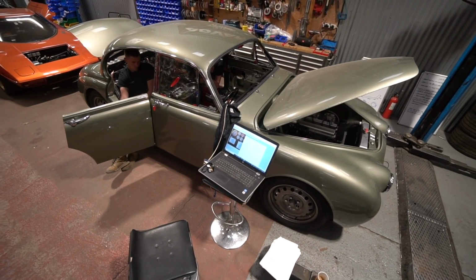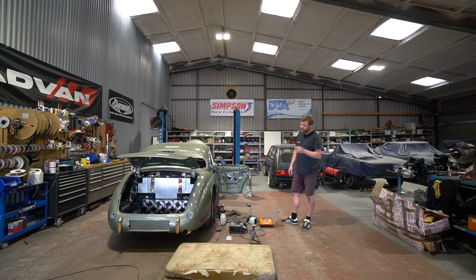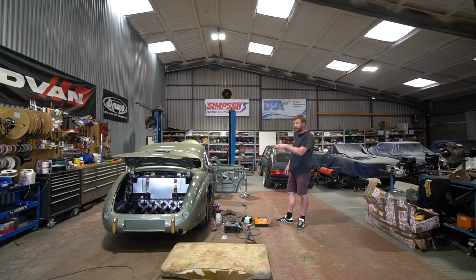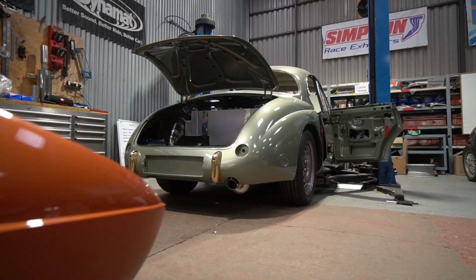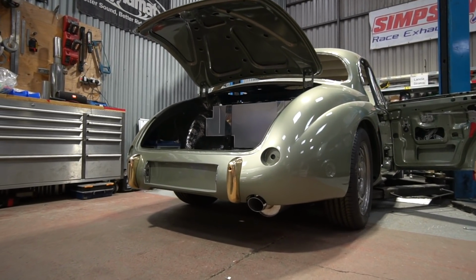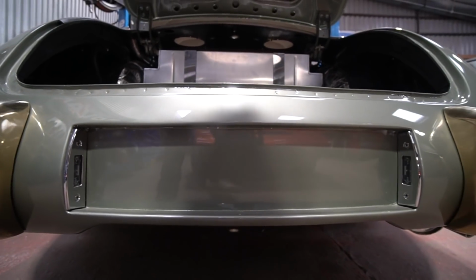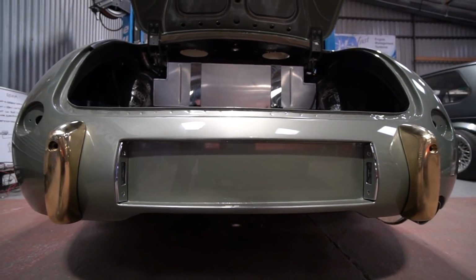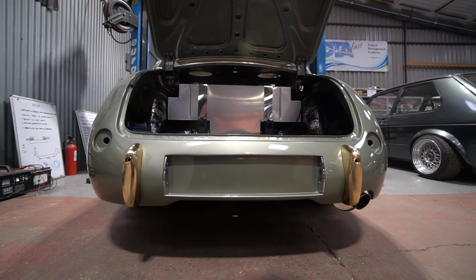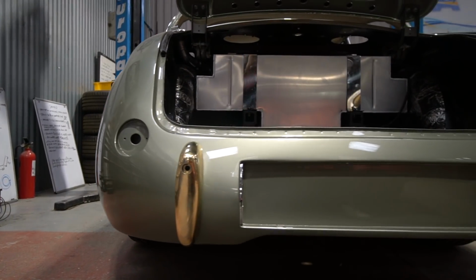Also looking at the back of the car, rather excitably, earlier today, the chap from Autodesk came over with the final rear overriders. Now, as you remember, probably an episode or two ago, they did some scanning on the back. We'd modelled the overrider shape in foam. They then went away, drew them in CAD, did a mock-up one machined in aluminium, and trial fitted that. We were happy with that, so they've now machined the final ones in brass.